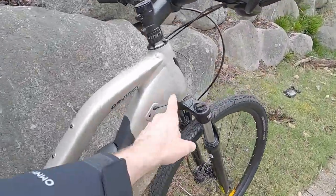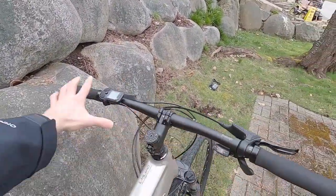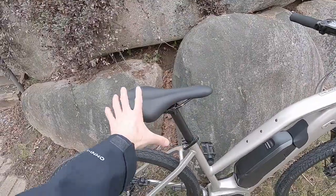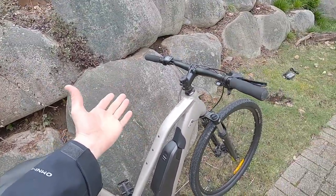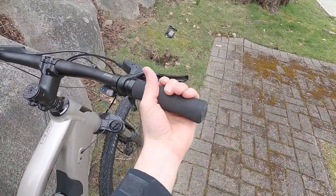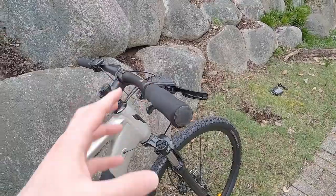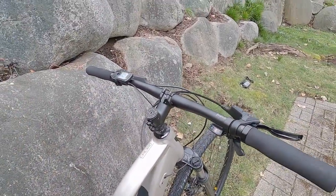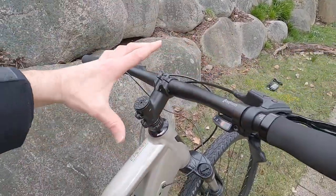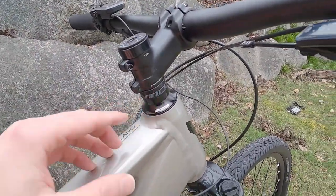On our way up to the handlebar, there's another internally routed cable here — that's for the display, which is pretty cool. Looking at the handlebar, there's a little bit of rise and back sweep, it's fairly straight, a little bit more high performance, kind of like the saddle, even though I would consider this sort of a hybrid bike. The grips are foam but they have this bulge in the middle — they're semi-ergonomic and they are locking, so not gonna twist on you. 17 degree rise, 70 millimeter stem — so it's not super long and it's also not flat. It's a little bit up, and that's part of what gives you that upright, more comfort-oriented geometry. Got a few spacers in here — two fives and one 10.